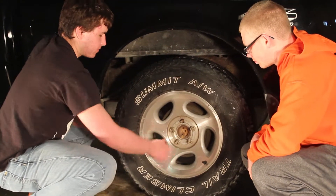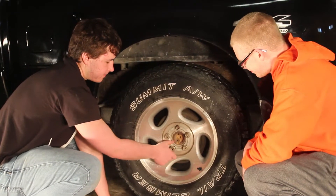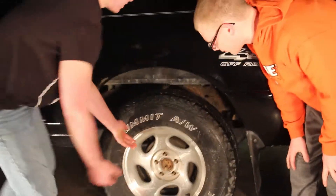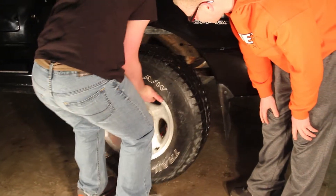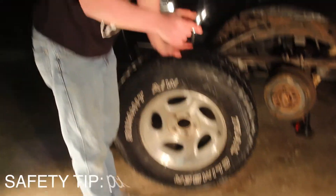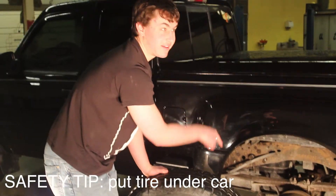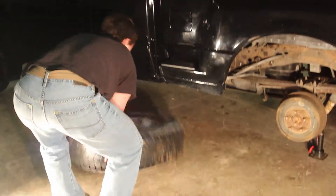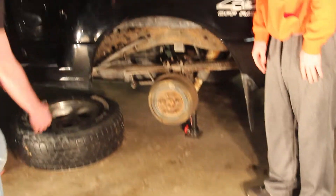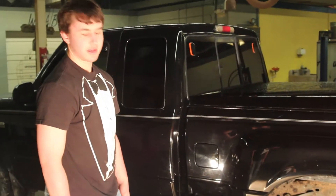Sometimes you might not have gotten them really hand tight — just go like that. Now we've got the tire, take it off — make sure it comes off like that. And a safety tip: you've got the tire out here and that jack is not very safe. Push the tire under the car like that — that way if it falls, it won't fall on you or completely to the ground.